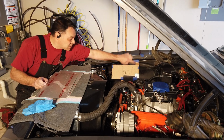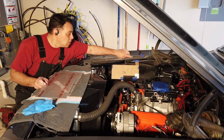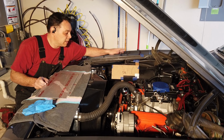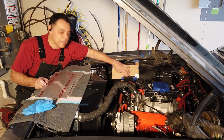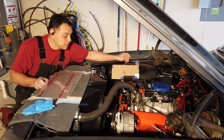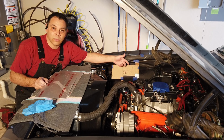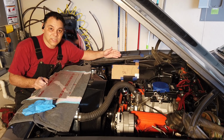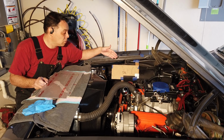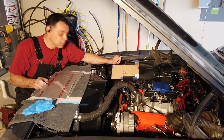If I set it up this way, make some tabs, basically legs for mounting, I can do one leg up against here, one leg up against here also, which shouldn't stick out into the wheel well area, and then two mounting positions, one down low, two down low, and that should give me plenty of support for this. That means that I'm only going to have two things sticking out into the wheel well, which will make me a little bit happier. The rest of it, all the screws and all the mounting things, and I'm going to try to use some Rivnuts, I'm going to put on this plate, and that way nothing will get in the way. Wish me luck.